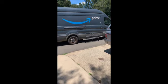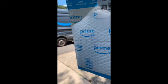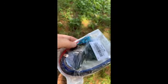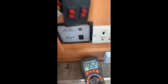And the switch just showed up in perfect timing on Amazon. I think it was like $15 for 2 switches. And here are the switches. Look like authentic Chinese quality. I'm sure they'll last at least a month or so. So I turned it off. I'm just checking the power with a multimeter just to make sure I don't zap myself. I've turned it off down here. Got the switch out. You just squeeze these little things down and work it out, and the other one should snap in the same way.